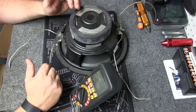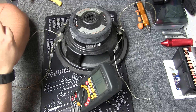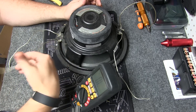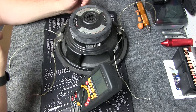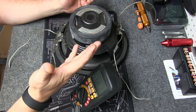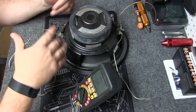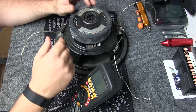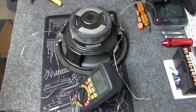Now this you can run — so let's say you had an amplifier that couldn't be bridged, but it's two channel and you've got 400 watts max, and you can run each of these coils or each of these wires to each channel to get the maximum performance out of this. Now if you had an amplifier that was two channel, could be bridged mono to one channel and was two-ohm capable, you can actually run both these together — positive to positive, negative to negative, parallel basically — and get even more power. So it depends on what your amplifier is capable of, so that's one thing you've got to figure out first.